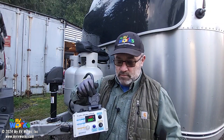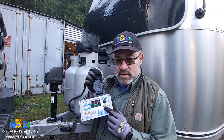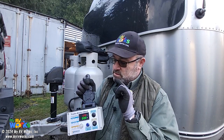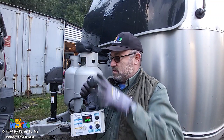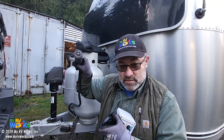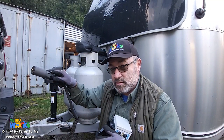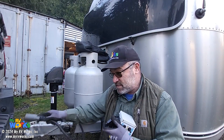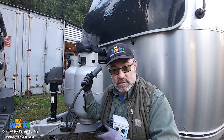Yes, I could do this with my meter, but in one shot I just found out something. The only reason this blue light should be on is when the brake is energized. And the only time this display should be on is if I have 12 volts in my seven-way connector — that is, this box is fed from my seven-way. If it was wired correctly and plugged into my tow vehicle, and my tow vehicle had one pin on the seven-way at 12 volts hot, then it's connected to my battery on the trailer.